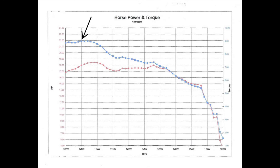We get asked, if the torque peak is at 10,500 RPM or 10,600, wouldn't it be better to slip the clutch at that point? The short answer is yes, it would be better if the clutch could handle the heat. But for the clutch to work reliably for 160 laps, that's 1,600 turns, or even for just a few laps in qualifying, you have to give the clutch enough time to cool down to shed the heat it generates from slipping off the corners.